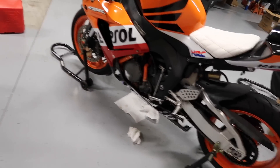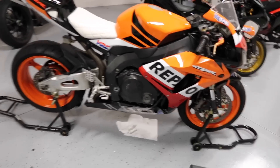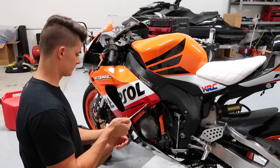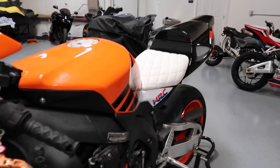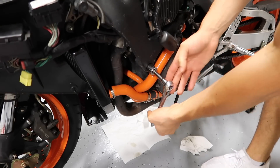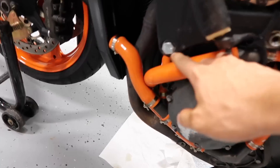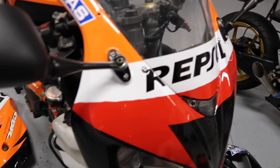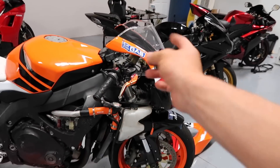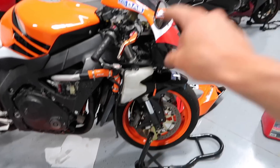I also strapped these plastics on since last time. We're back — got the hardware. I'm going to pull these side fairings off then mount them back up with this. I'm definitely going to mock up these side belly fairings, make sure they're 100%, and then go over the rest of the stuff — I still need to put the grips and levers on. When you're putting new fairings on a bike, always leave the whole front end loose because when you crash them, if you still have that front stay bracket on it, it'll readjust and the fairings won't want to line up properly. Always leave that loose, mount everything up, have all those holes lined up properly, then tighten down the front stay.